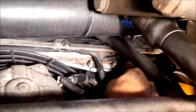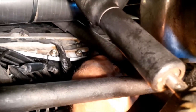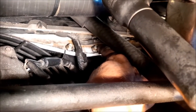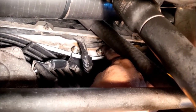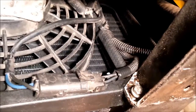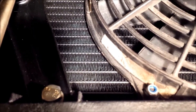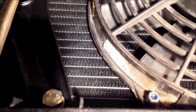In particular, when you're putting those top ones back on, don't forget to put that little earth clamp back on as well and make sure that's a nice clean earth there. That earth wire is the sole earth for both of the radiator fans, so you need to make sure that's nipped up nice and tight and clean. Once you've got them all started, nip up the 6mm bolts to about 10Nm. Do the 8mm bolts up to 20Nm. And that's it — job's a good one.